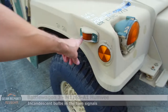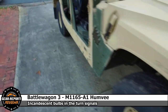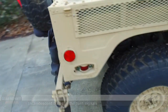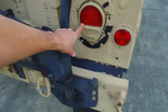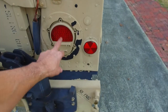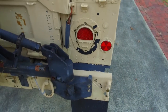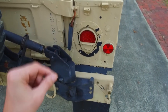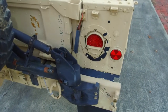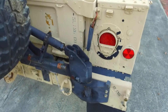These trucks have LEDs on the side markers, but oddly use bulbs in the turn signals. One of the first things I did when we got this truck was replace the incandescent tail light, brake light, and turn signal combination with LED lights. I think between LED headlights and LED tail lights, that's the very first thing that just about everyone should do with a military Humvee, because the stock ones are really less than adequate.